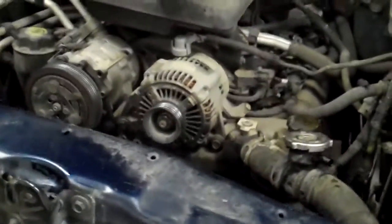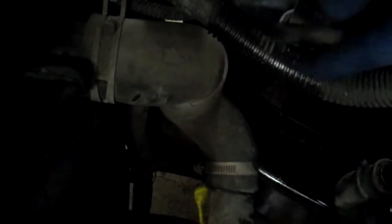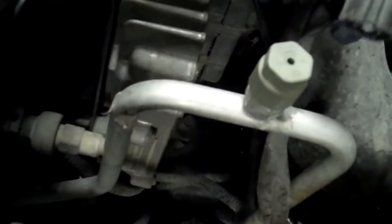First thing you want to do on this truck is remove the two bolts. One, you reach down around behind, you see where it goes in right there, and remove a 10mm bolt. And then you've got the same thing on the mount just right over there, kind of over and down from where the AC low side is. But anyway, you pull out those two bolts, you want to undo the line from the squirter, and then you also want to undo these two plugs.